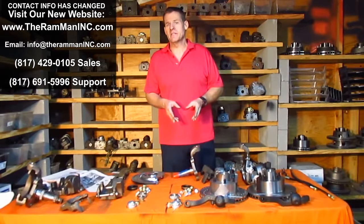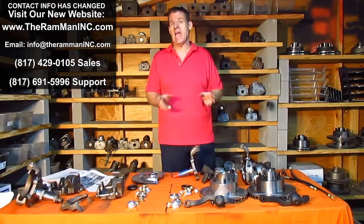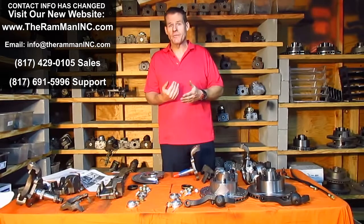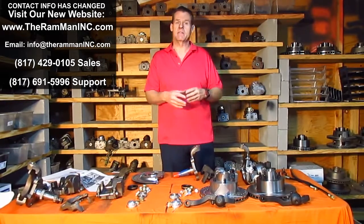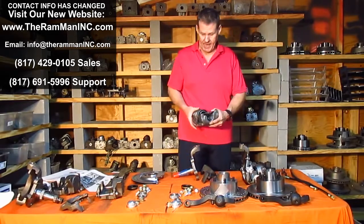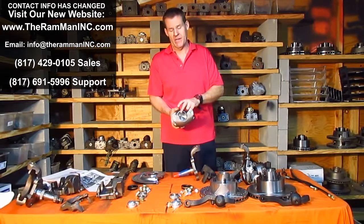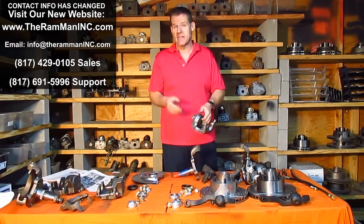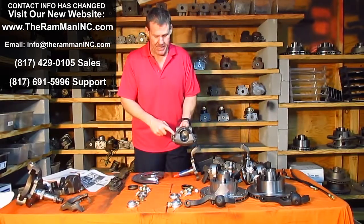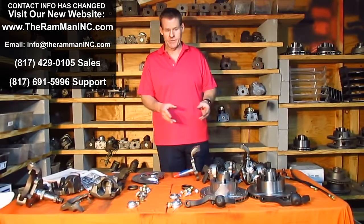The correct way to put disc brakes on an earlier Mopar is to bolt on 1976 A-body components. The reason you choose '76 is that the 3, 4, 5, and 6 era does fit, does bolt on, and does work. But in 1976, Mopar went to the full size 2.75 inch piston, which they had been using on all the Kelsey Hayes calipers since 1969. The C bodies, the Imperials, Big Pin calipers all had a 2.75 inch piston. So it gives you much better clamping force, given the option.